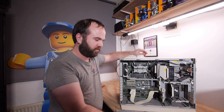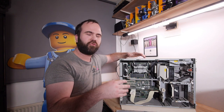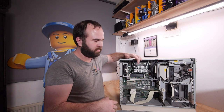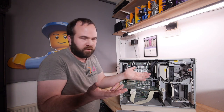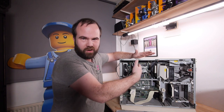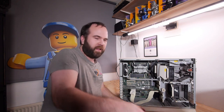That was a little too expensive for me, because I really wanted the Compaq DL380 — the first generation 3U machine with 64-bit PCI slots but only four hard drives and dual Pentium 3 933 or 1 GHz. I found this one for 25 euros because sometimes I just drop a bid on something and see what happens. What's missing is the 64-bit PCI slots, but we have the new-style hard drives and we can install 10 of them, so I still like this one.